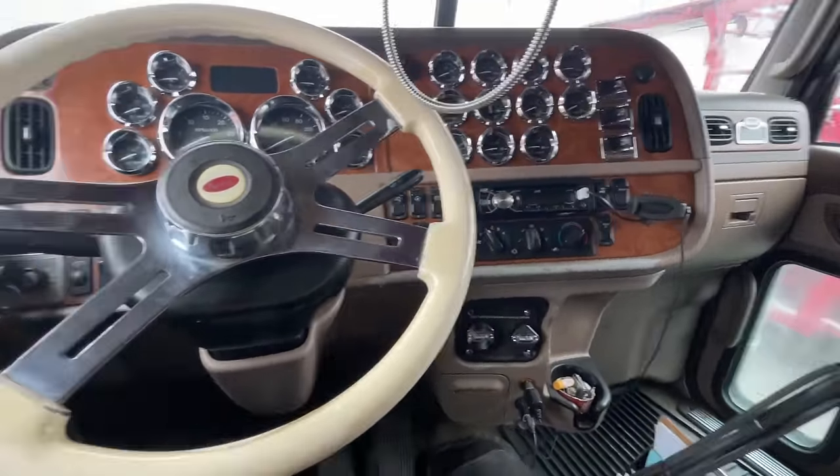Now you notice I came to a complete stop with the clutch in, and now I shift to the gear. And here we're gonna do the same pattern, but Jake in between each of the points. And it drops you into the gear a lot quicker. Now here, we'll go straight from seventh to fourth for a corner. Same deal again, except whole gears. Whoops. Didn't quite get the Jakes to activate that time. There, I just missed a gear. And when you miss a gear, you get off the throttle or on the throttle, depending on if you're high or low of the gear, and try to find it again.